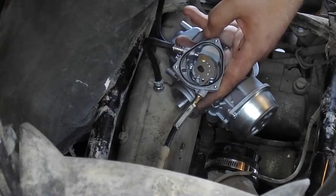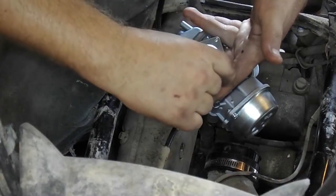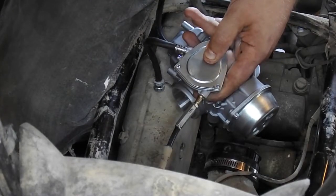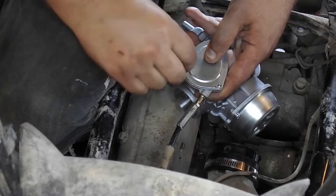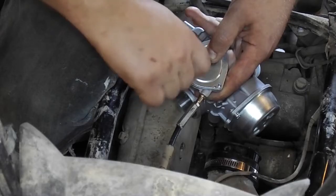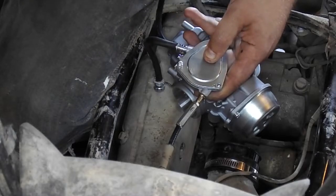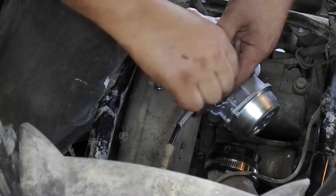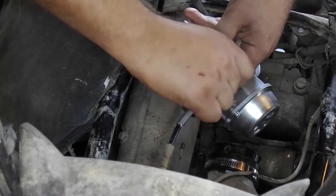Once complete, place the cover back over the throttle housing. Make sure to place the small gasket into the groove on the carburetor before placing on the cover. Do not twist the cover to line up the holes for the screws because then you will mess up the placement of the gasket. When placing the cover, line up the holes as you place it down and then hold down firmly with your thumb or another finger while placing all the screws to hold the cover on tightly.